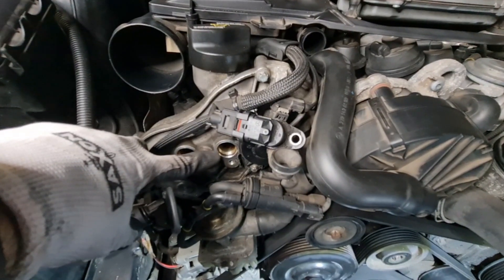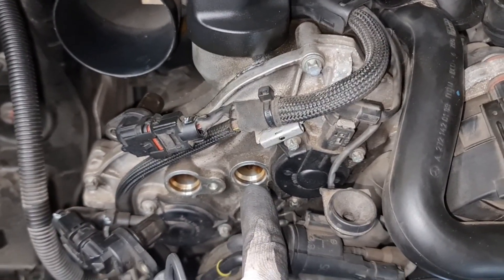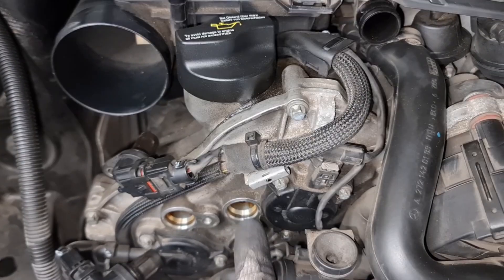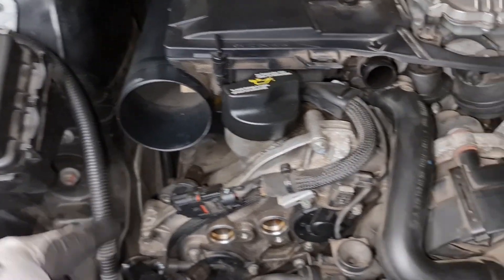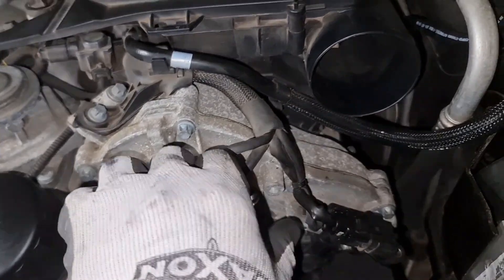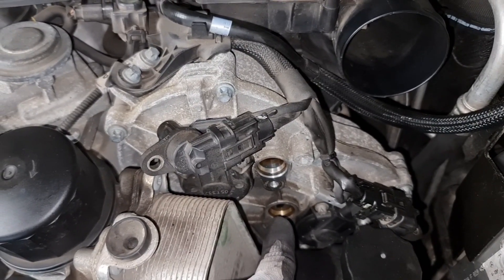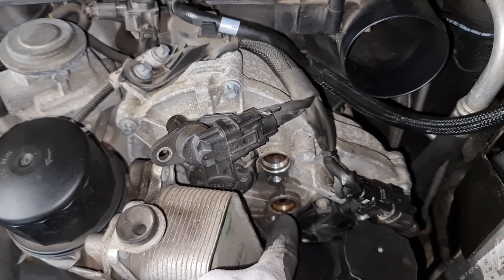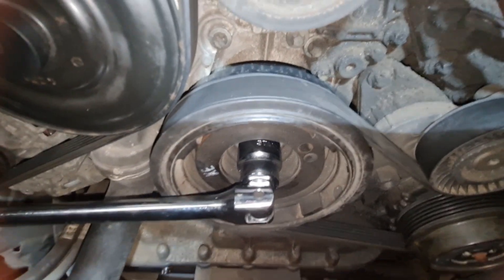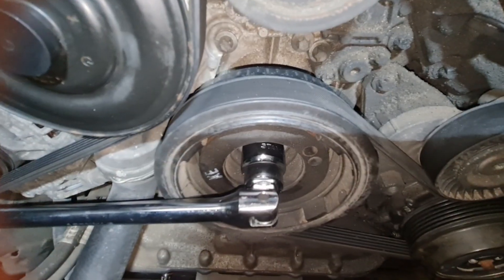To perform the physical check, first remove two sensors — one from the right-hand bank and one from the left-hand bank. These are the camshaft position sensors. You need to take the camshaft position sensor from the intake side, as well as the exhaust side. The sprocket for the exhaust cam is geared to the intake sprocket, so you don't need to check those, but I've removed them out of curiosity. Once you remove your sensors, you need to come down and use a 27mm socket with a long handle ratchet.